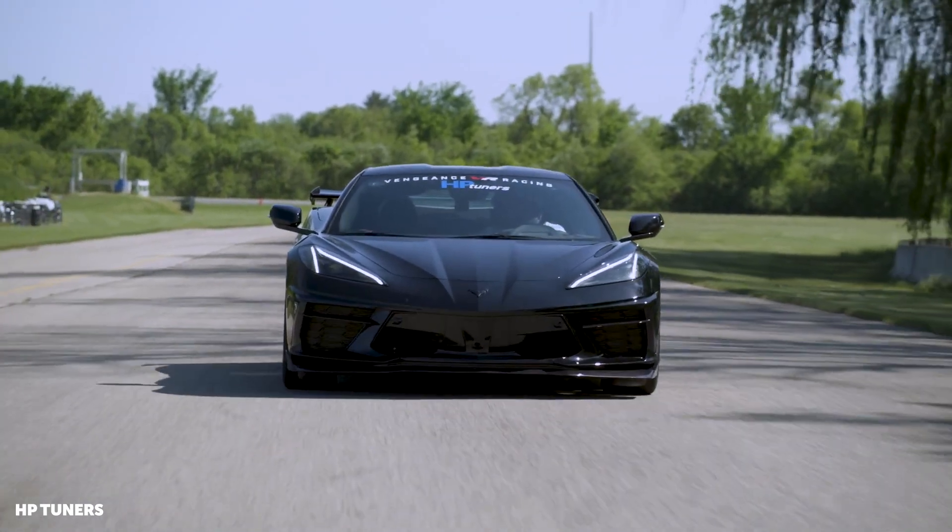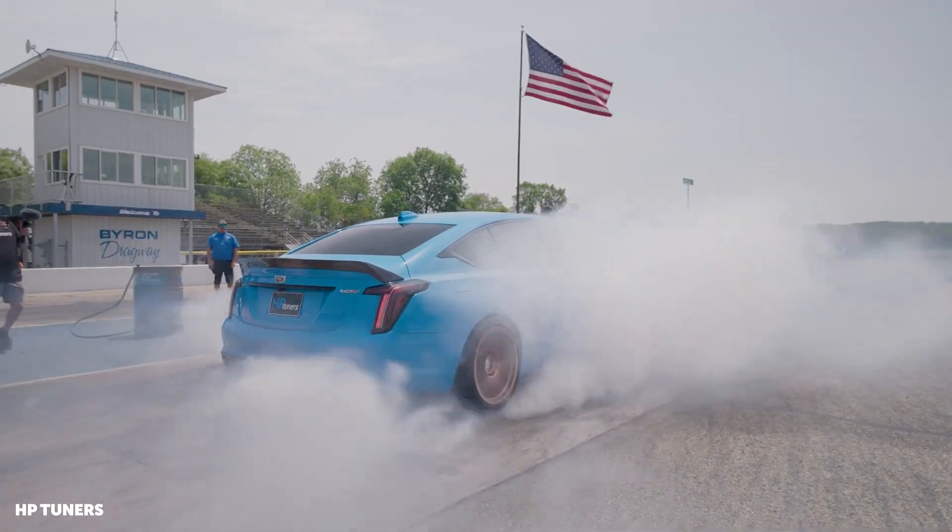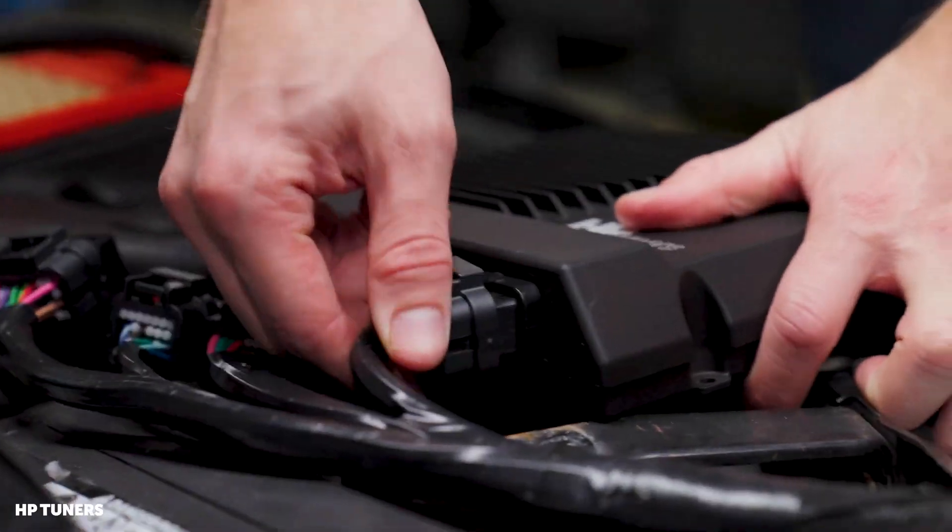Looking into the crystal ball, are we expecting the Core standalone to be a solution for very late model vehicles where you can't easily tune the factory engine control module? And I assume you'd need a huge layer of complexity in terms of CAN bus communication specific to that vehicle to keep all other controllers and modules happy. That's kind of the reason we went CAN bus heavy on the Core. The new Core has three CAN bus networks — one specifically for HPT net, which will be our line of accessories, and the other two are completely unrestricted CAN bus networks where you can customize the communications, addresses, and speeds to make it work with other CAN bus modules or to piggyback on an unsupported ECU for additional port injection or anything like that.